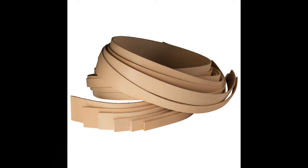Before asbestos, the problem was that they just didn't last very long, which is why you saw a lot of external brakes and a lot of banding that could be accessed from the vehicle without too much difficulty. If it's too far internal and it's a constant wear item, it's just going to make the maintenance of the car that much more difficult. So those types of bands, before the asbestos days, were going to be fairly easy to get off and on, and they were known to be points of wear, especially the ones using canvas and cloth. They also tended to catch fire a lot.